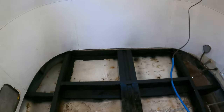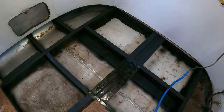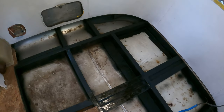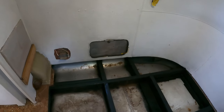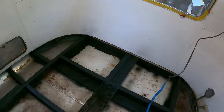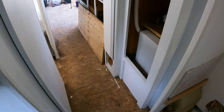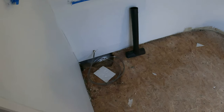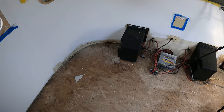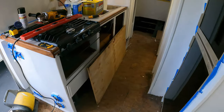Subfloor repair is happening this weekend. We got this frame all refurbed essentially — we ground down as little as we had to, got some rust off, and got it painted with Rust-Oleum. We're going to be putting in some new insulation. We've got this channel just about all cleared out all the way around. We're going to be cutting some new subfloor plywood, getting that installed with a little help from our friend Alex, and then start moving on to our vinyl plank flooring. We've got quite a few trouble spots though — this corner here is completely rotted out, and some issues around these battery boxes.